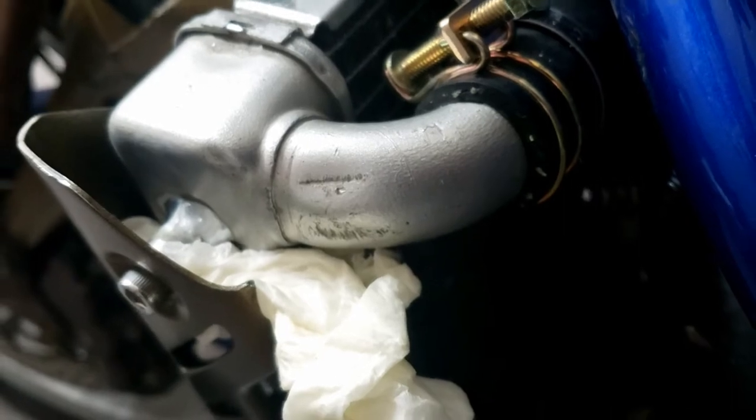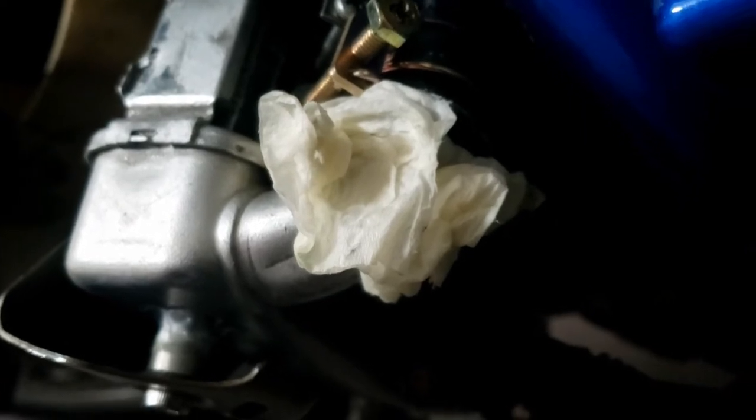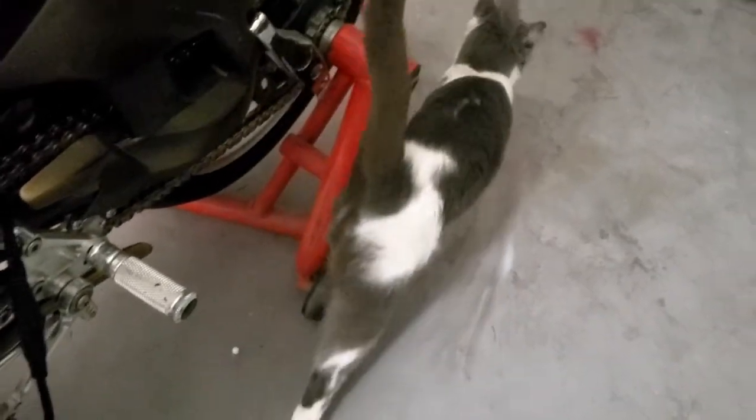I thought it was going to be the bottom one because that's more mangled — that's where the actual damage to the radiator was. But it appears to be the top one, so that's good. Don't know what we're going to do about it, but we've identified it. I really don't want to be taking the whole radiator off again, so I might try some of that aluminium welding stick stuff. And that confirms it — because I moved the other flow-stemming device higher, and yeah, that's cured it.